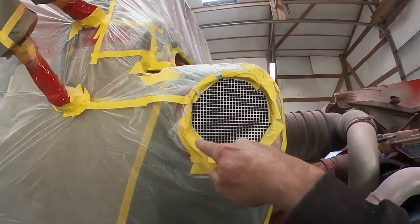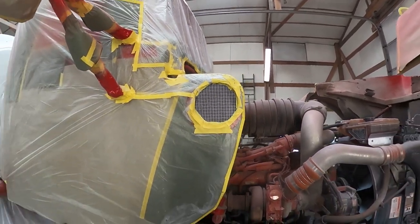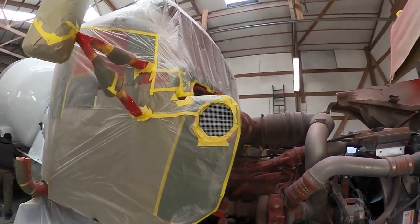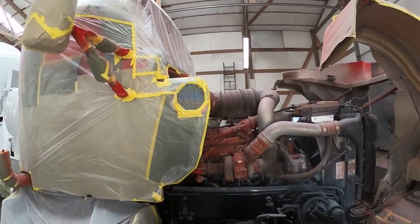You can see how the white paint turned this vent — that was painted red — white, because this truck had to pull in a certain amount of that while I was painting. I had to have the truck running while I was painting so I could turn the drum. That happens every time, and that's why you can't mask these up — the truck has to breathe. That's why I couldn't have the hood down either.